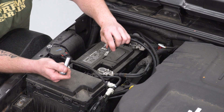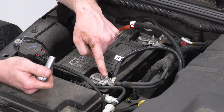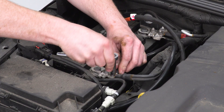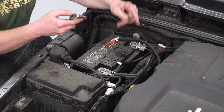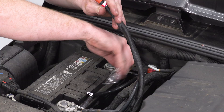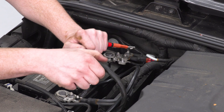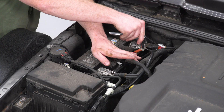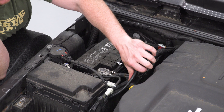All you need to do is hook these cables on. There's a little pin right there — you don't want to take this nut off because that's what actually holds this terminal onto the battery. Since I didn't have a nut on this stud, I went and got one out of my toolbox. Take one of these other nuts off — not the one that holds the terminal tight. Positive is going to go to positive: that's the two red wires — and black is going to go to the negative. Then go grab some zip ties and get all of this out of the way, safe and secure.